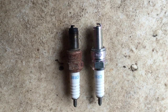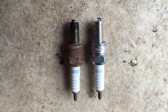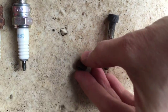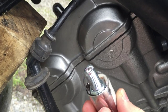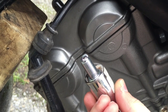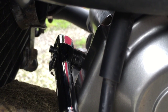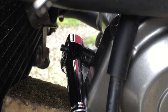Old and new spark plug side by side — you can see just how corroded the old one is. It's at the front of the bike, so that's where most of the wet hits as it flicks up off the front wheel, even with a guard on it. Because of the corrosive state, I've also bought replacement nuts for the radiator. We're carefully going to put the new plug in by hand because of the aluminium threads. Since it's brand new, once hand-tight we do half a turn — I've put a permanent marker line on my socket so as soon as I see it come round I know it's the correct tightness.